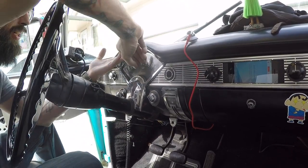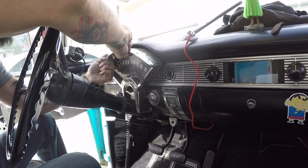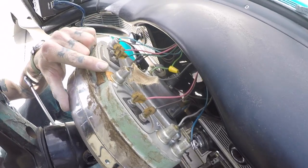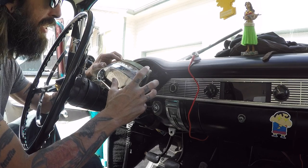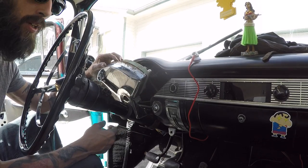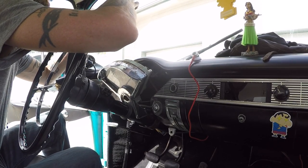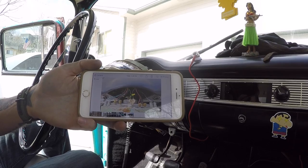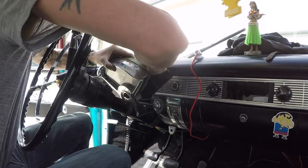Put the three screws out, the front face plate removed, and we can pull the speedo out. A lot of these older cars, the wires aren't very clearly defined or marked, and even if they were from the factory the markings may have rubbed off. They didn't have specialized plugs that only fit certain holes — they all just kind of connect to one another. So it's wise to take a picture of the wire configuration before you disconnect any wires, so you can always look back and remember where to put what.